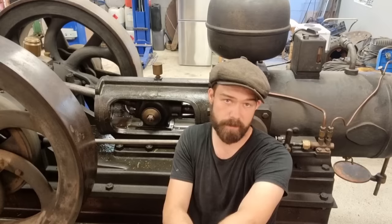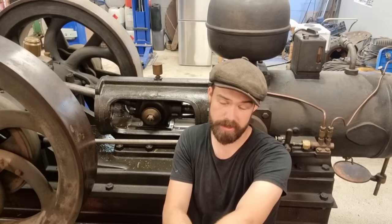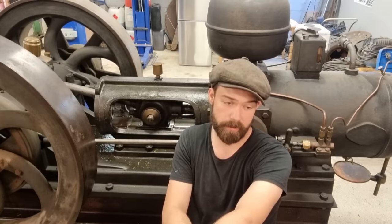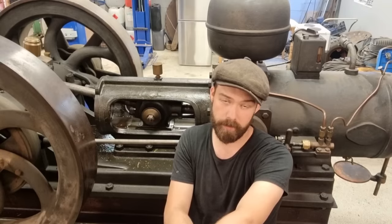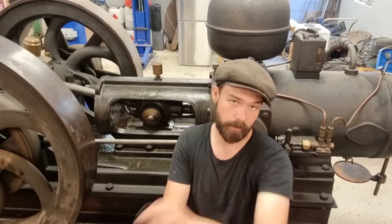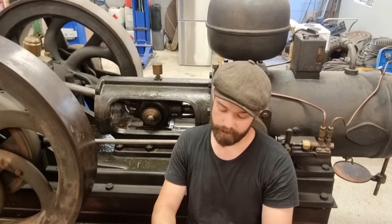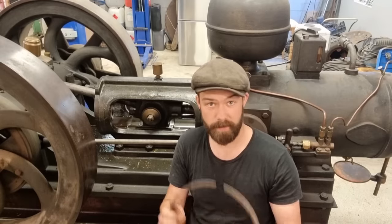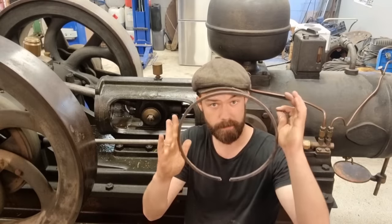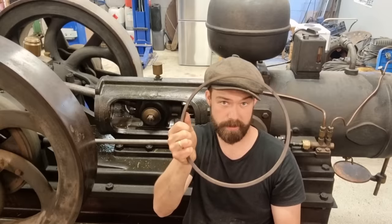That ain't fully true. Of course they can be, but you have rings in cast iron bores that are made of steel that is plated with nickel, copper, chrome and so on. So if the cylinder gets oiled, that won't be a problem at all. And I have some books describing rings that only say that cast iron should be used, nothing more. So if you find something that fits your measurements for making a piston ring, use it, if it's cast iron.